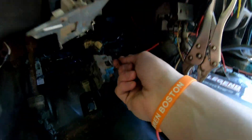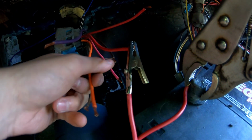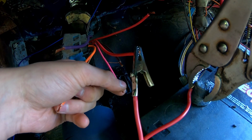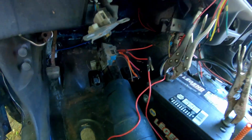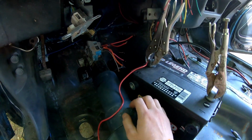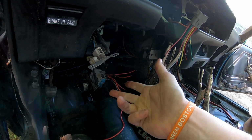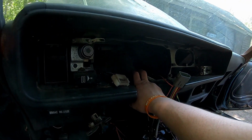So this purple one here only turns on when cranking, so that's gonna be my starter relay wire. This pink one does not turn off when cranking. So not turning off when cranking means it has to power my CDI box and all of my engine running stuff, because if I run one of these wires that turns off when cranking, I'll never get spark. So yeah, essentially, this pink one is going to feed a distribution bar. That's going to run my coil, CDI box, and sniper. Also going to run my gauge cluster since it's LED now, so it shouldn't take too much power at all.